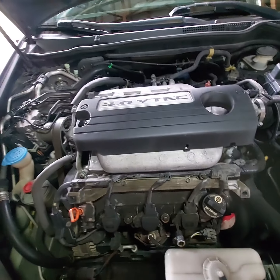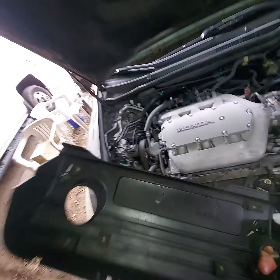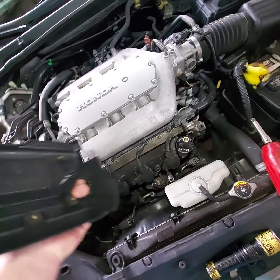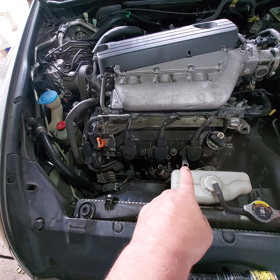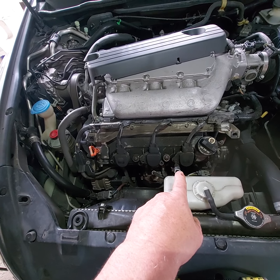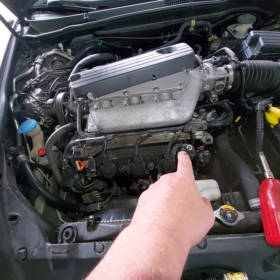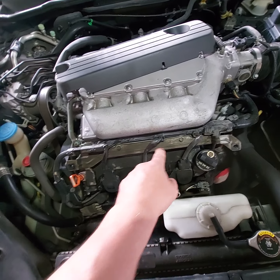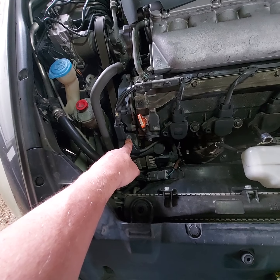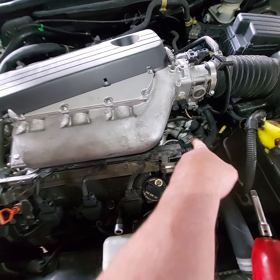You've already missed most of the fun taking this front cover off — just two little screws, turn them a quarter turn and they release right out. We're going to take the ignition coils off with a 6mm Allen wrench. Take those three out and leave them connected. Take these two 10mm bolts out, and this bracket with the harness — probably take that 10mm bolt out and just roll it forward.